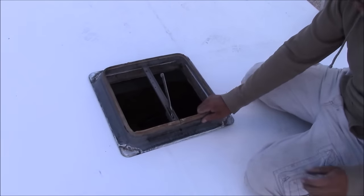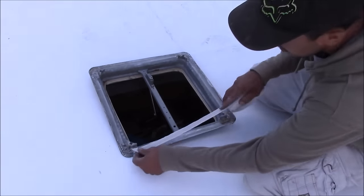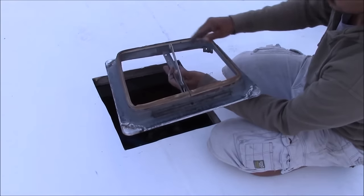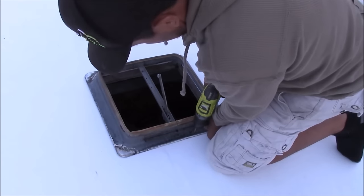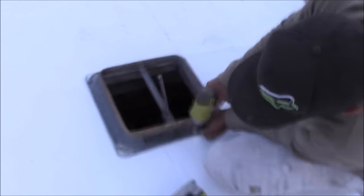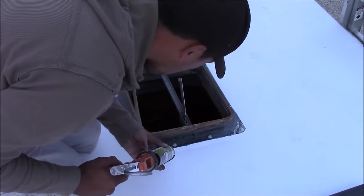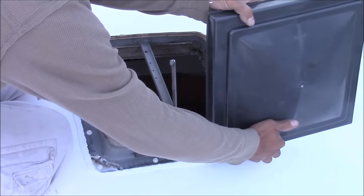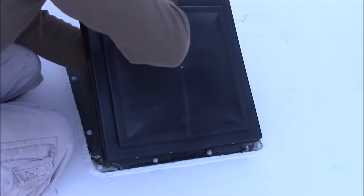Now it's time to start installing all my vent housings and covers. I'm going to start off by putting a layer of putty tape on the bottom for my gasket. I'm reusing my vent housings — these were just clamped on before with no screws through the top, so I'm actually going to use some screws this time to secure them. I'll pre-drill all my holes and use roofing screws to secure them, then seal the edges with lap sealant, then slide my covers on and attach the hardware. There are various different covers out there, so yours may secure with screws, but they're all pretty straightforward.